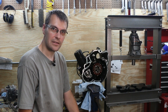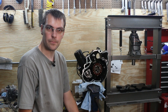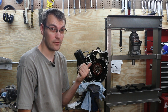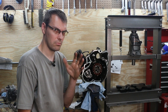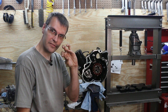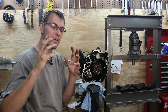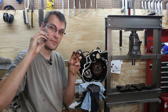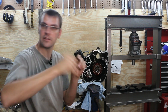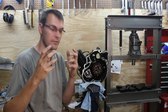The problem with that is you're not directly oiling it. The supercharger in these could be spinning at 50,000 RPM or thereabouts. And if you have something spinning that fast, the amount of force trying to sling oil off of it is incredible. So directing a little mist or even a jet at it, it's just going to bounce off and fly away — so nothing's getting oiled, nothing's getting cooled.